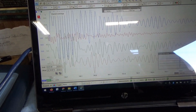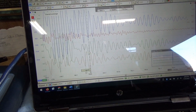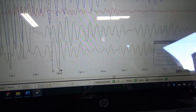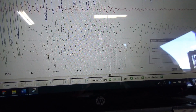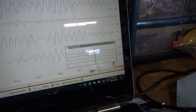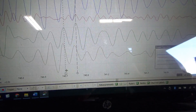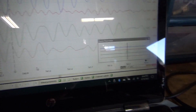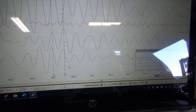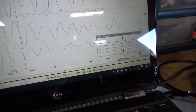So what's the frequency? On the PicoScope, very convenient — just drag your cursor peak to peak and you'll see the actual frequency. Going from green to green right there: 7.5 kilohertz. That's very close. At this scale, wherever you put the cursor is going to make a pretty big difference in the frequency. 7.2 kilohertz — that's exactly what the specs said. So three of these sensors are good. The one that the car was fussing about is obviously not good.